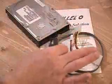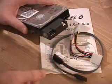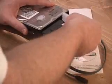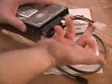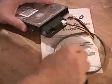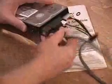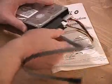I'll show you how this is installed. This first of all goes into a regular standard ATA-100 or ATA-133 hard drive. You plug it in the back like so, then you make the necessary power attachments. You plug it right here as well as into the back of the hard drive, and then this goes into your power supply. Then connect the serial ATA cable into the back right here and then connect the other part directly into the motherboard.